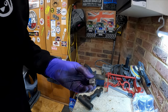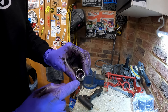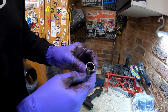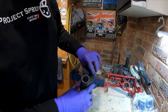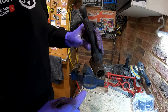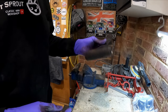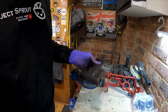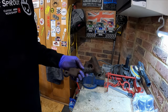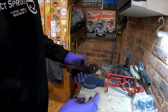That side was pretty much perfect - I didn't cut all the way through, I literally just made it nice and thin, and then you just strike it on the corner and it will crack through, and that allows you to get it out. There's a tiny little bit picked up on the inside there, but it really makes no difference at all. I need to get these arms cleaned up in some brake cleaner in a moment. Let me get these bearings out and then we'll get them cleaned up.